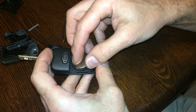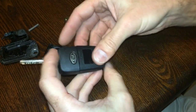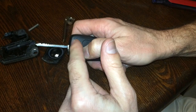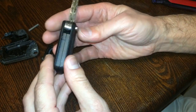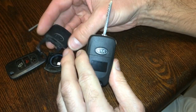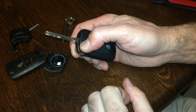Go ahead and put the battery back in. Make sure it slides under those two little pegs right there — if not, it won't get a good connection. Now go ahead and put the back on. Everything looks good, lights work in there — that wasn't working before. Close it up — look at that, nice tension, pops right up, everything looks good. We also went ahead and moved the Kia emblem that was originally on the back of the old one — it just has a little bit of adhesive on it. Key opens and closes perfect.